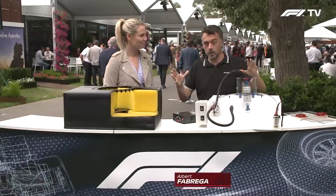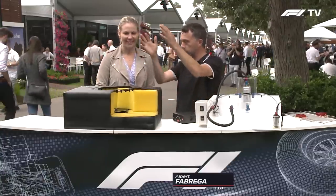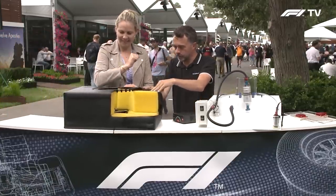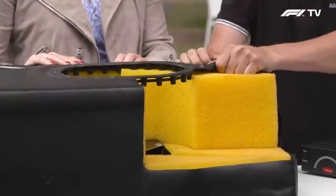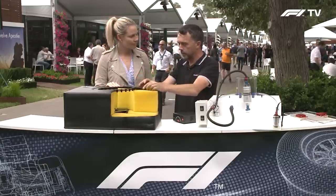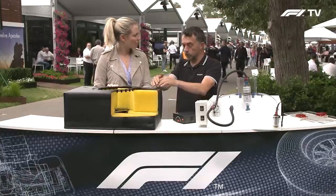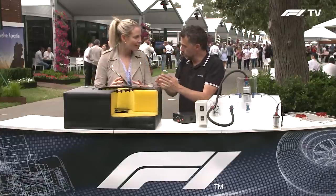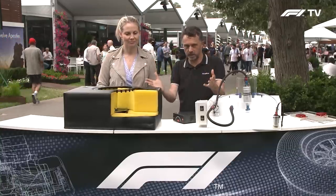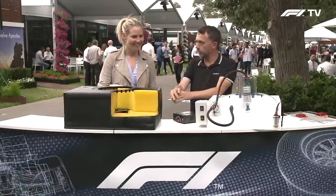The first thing to understand is how a fuel tank is made. Here we have a smaller fuel tank — this is not a Formula 1 size, Formula 1 are bigger — but just to show that they are not solid, they are not rigid. You can push as much as you can. This is a single rubber bladder piece made from Kevlar fibre with a coating of elastomer, like a rubber, that makes it really soft. This is because if we have a heat, if we have an accident, we don't want it to crack — no splitting and no leakage. If fuel escapes from the fuel tank we can have a big fire, and we don't want that. So that's the reason we can try to puncture it, hit it, and it will never have a leak.